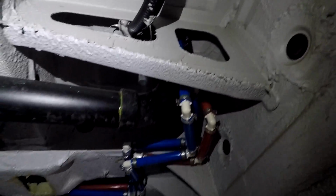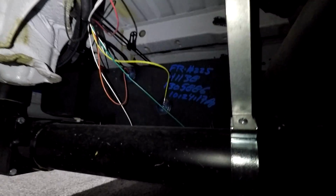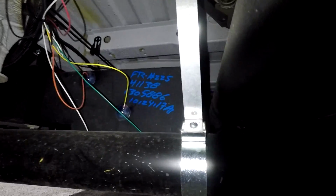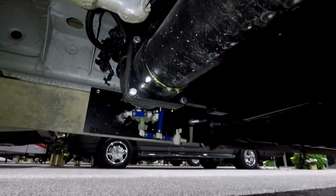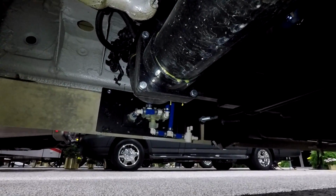No. So those are water lines. They are running outside, so... All right, well, we'll give them a little ding for that, but they don't say this is a four-season coach, so it's fine. You just got to be careful you don't freeze. That's the gray tank. Now, I'm noticing an older style of tank monitor. Those are kind of probes that go into the tank as opposed to sonar. That is the backside with some exposed water lines of the service center, where you fill. Yeah, okay.